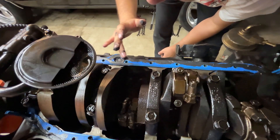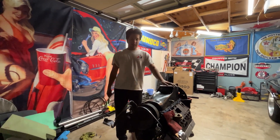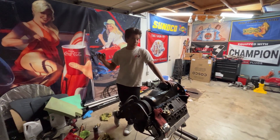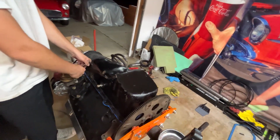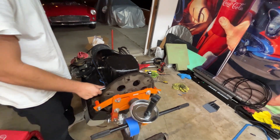I am just absolutely covering this, making sure I don't get any in the engine itself — basically just a bunch of gooey stuff. We're bolting the oil pan back on, so we got a brand new gasket, all kinds of RTV — the good old sticky stuff. It's almost ready to go, just making sure it's all tight. Got the new bung fittings right here — that's just gonna go to an AN line that goes right to the bottom of the turbo for the oil return back to the oiling system. Really pretty simple. It's just kind of crazy how we're like, oh, we're gonna add some AN line — boom, motor's out of the car. But you've got to do it, you've got to do it properly. You've got to do it right.